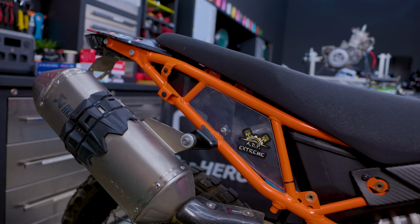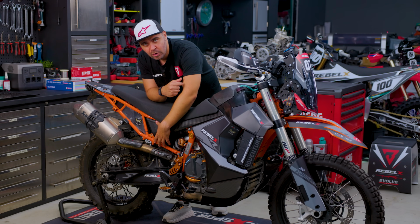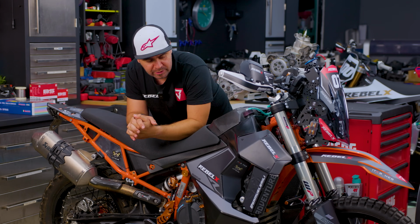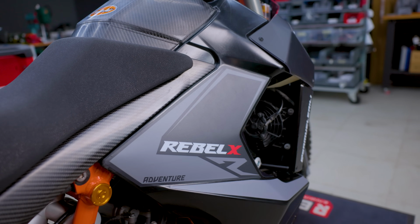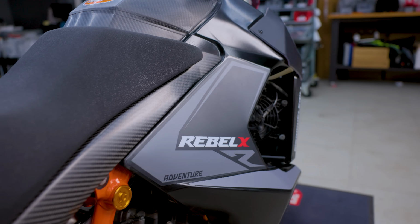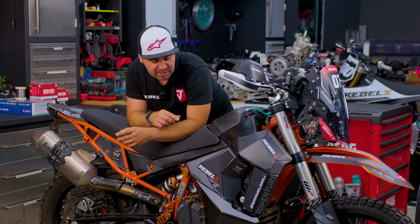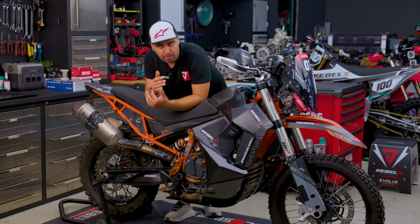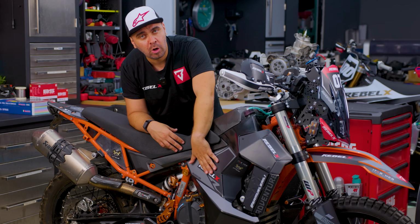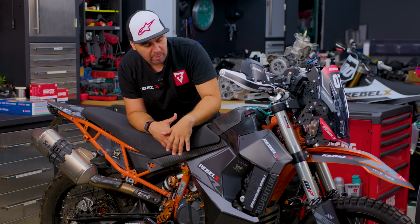And here a piece of plexiglass was placed in order to protect inside but still leave all the frame visible. The graphic kit was produced here in house with a special material that has a super high-tack glue and a matte finish, together with a matte lamination, 300 micron of thickness plus 250 microns of the print sheet, so that's almost 600 micron. This also provides a cleaner look with no air bubbles, but also protects everything more from scratches.